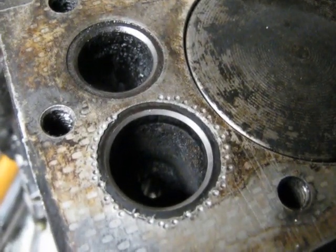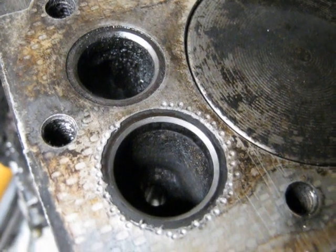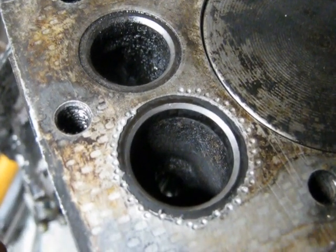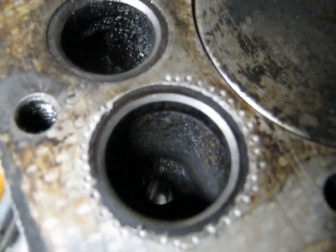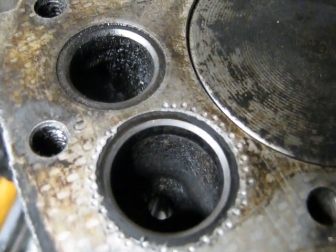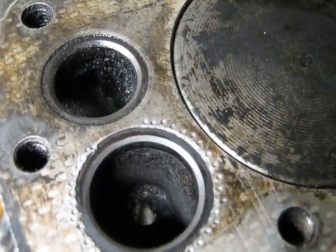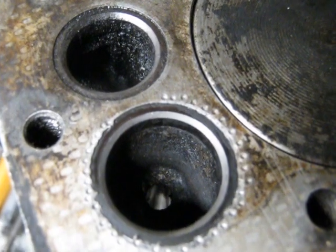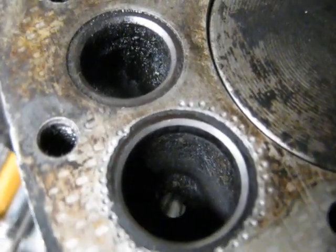I just wanted to mention one more thing: the reason I've done this is that the valve seat will rotate around as it gets loose and can eventually bore its way right down into the block. Once it gets a sixteenth inch of clearance — or could be less — it'll just start vibrating around in a circle and compression will leak out past it. It'll get to the point where the engine probably won't even run. That may have been why this engine was in the scrap yard. This one wasn't what I'd consider extremely loose, so if you get to it before it's very loose, you can save the engine — because once it's bored itself oversized, the engine block is pretty well done. It would cost too much to repair at that point. That's why we stake them in like this: to prevent rotation of the valve seat in the engine block.